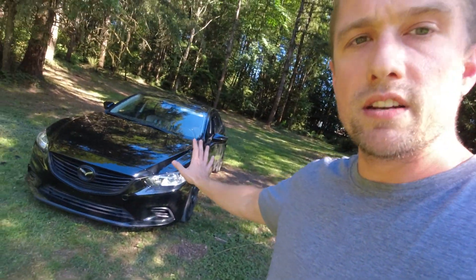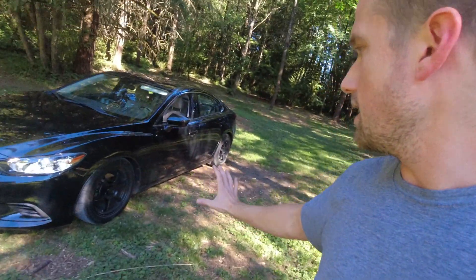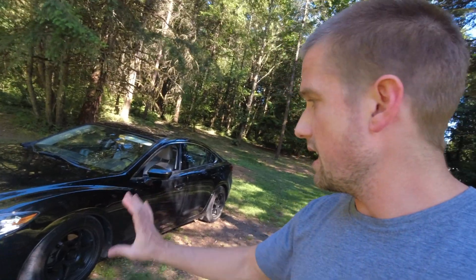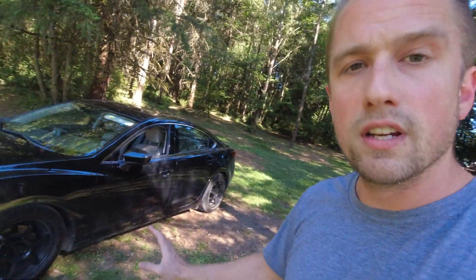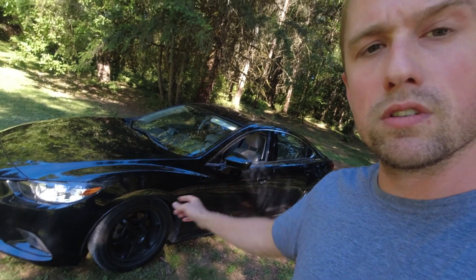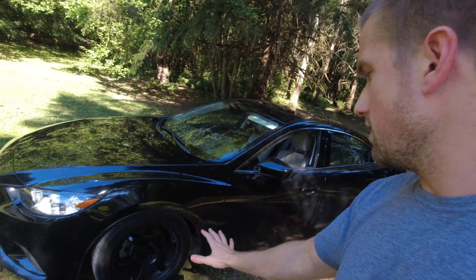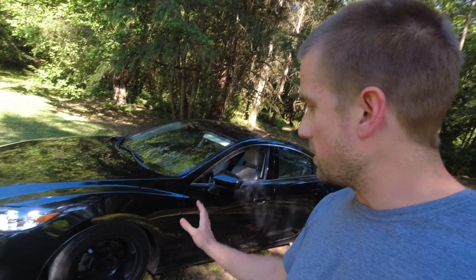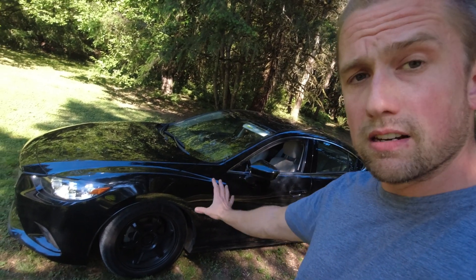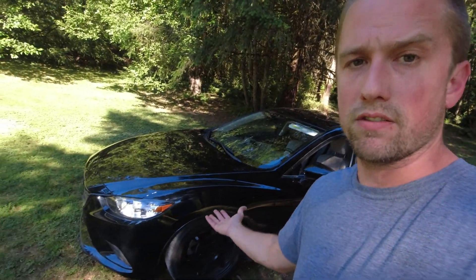Even before we get under the hood, I thought I'd just walk around a little and talk about some of the other stuff I've done around suspension and everything else. So the first thing obviously is I have some aftermarket wheels — Motegi Racing. They're fantastic. These are 17 inch, so I actually went down in size from the 19s that came stock. This is a lot lighter — it's over 10 pounds lighter per wheel, and the tires are half as much, and it doesn't seem like I lost anything from a cornering perspective.